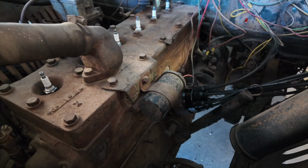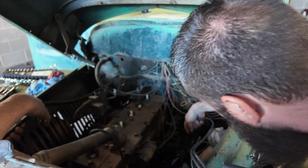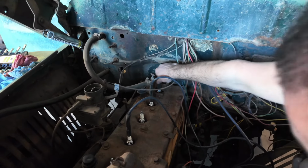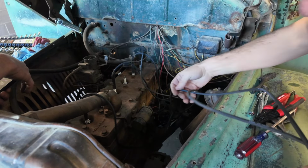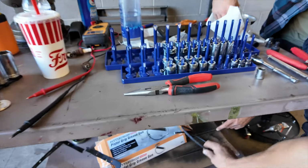Be number one right here. One. Two? Or what's the next one, Stubbs? Five. I'm going for five right here. Next. Three. Six. You got me a wire made up for the center. What's the next one? Two. And let me guess, the next one's four. Okay, now I need coil wire. Coil wire one, we're good to go. Gonna be a short one.